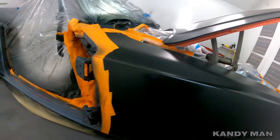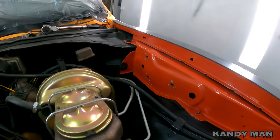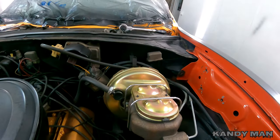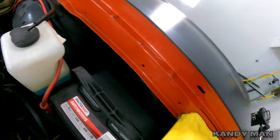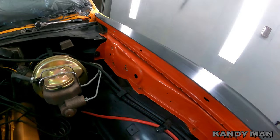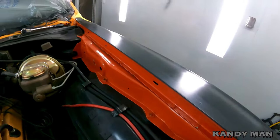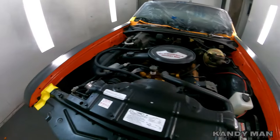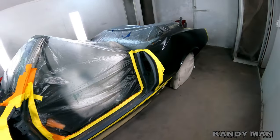So we have the hood off and I wanted to show you guys what I was talking about. See how this is all black? The back firewall — I want to leave that all factory looking so when you open up the hood it looks original because I have all the original stuff under here. So we're going to tape this off, and it's a lot easier than taking these fenders off and having to realign all this stuff back up. Now all we got to do is align the hood hinges back up and we'll be good to go. The hood and hood hinges are off and we're ready to prep these out — the rest is already prepped out, taped up, and waiting for the bag.